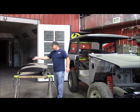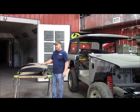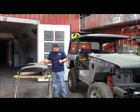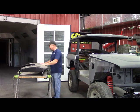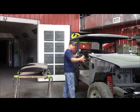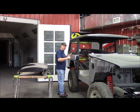So what I'm going to do is — I've already cut the landing inside the inner fender here to where the hinge mounts on — I'm going to take the hinges and mount them in the center of their adjustment location so that I have adjustment all the way around. Then I'm going to move that structure in this fender to make all the sheet metal line up. Once I get all that lined up, I'll put this piece up on the Bronco and move it to where it lines up, and I can still move the back quarter and just work my way all the way through, tagging that in place.